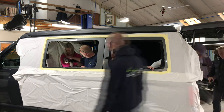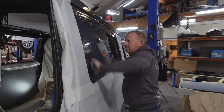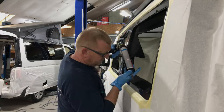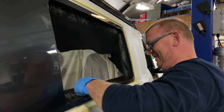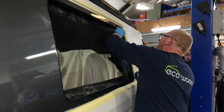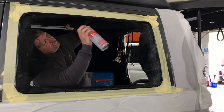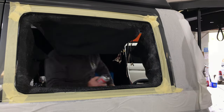The sliders are fantastic in the aftermarkets. I chose a sliding window for both sides — the sliding door and the offside. Craig will be using some PU to fill up any holes from where the factory might have missed between the two skins. And that primer is essential to put on the edge — that will stop any rust for the life of the van.